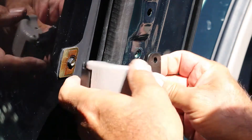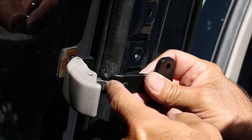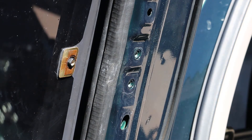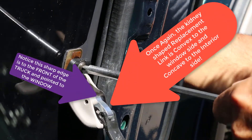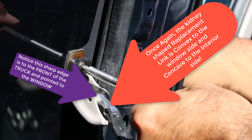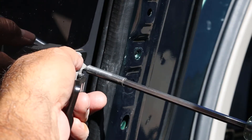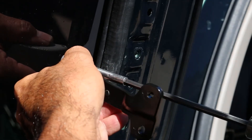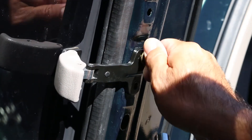The link pin has been replaced. The proper orientation for the link pin is: when it's fully extended, you see how it's concave right there, and there's a little sharp nub on the link that goes towards the outside. We're going to start by putting the screw in — remember you have to hold it on the back side and it is keyed, so you'll just barely start it. Make sure the square part goes into the indentation, then line this up, test fit it — it's lined up perfectly. Now we'll tighten it all the way, insert our two 10 millimeter bolts, get those tightened down, and that should do it.